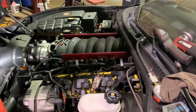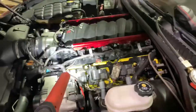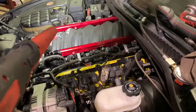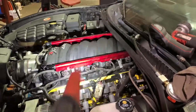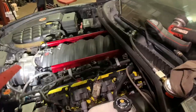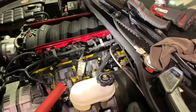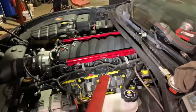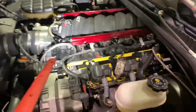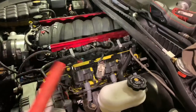So now what we're waiting on: tomorrow I'll get all EV6 pigtails. As I said in a previous video, I don't like these injector adapter clips — I now have two broken clips, and they're brand new. To me that doesn't sound like a good idea. It's a really easy way for me to be driving and have one break, causing a lean condition or a random misfire I can't fix. Plus it's just another point of failure. It's just a piece of plastic that converts from one shape to another, but it is another point of failure. The EV6 pigtails are pretty much just as cheap as the EV1 adapters, and I can get them at parts stores. So to me it's a no-brainer to just switch them over, especially since we already have two broken injector adapters.